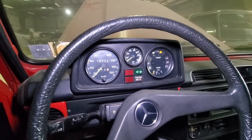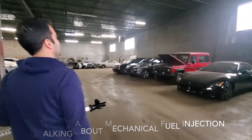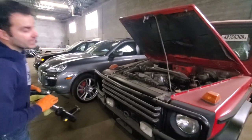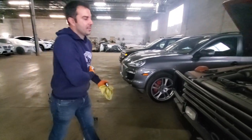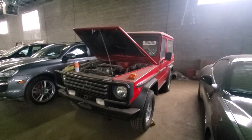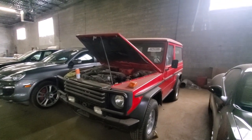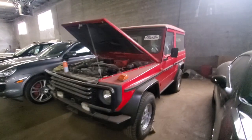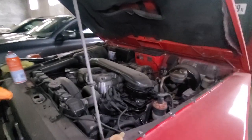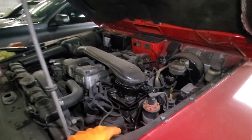The integral and one of the most complicated and expensive parts of these Mercedes - whoever owned this car completely eliminated it for a way older technology that's supposed to be inferior, but in reality just works. I'm feeling a little bit defeated. I know there's probably some carbureted American cars over there that we can get fired up. But I want to get one old Euro car started, and this is so par for the course that none of these will run. Check this out - this is very unique. It's another old G-Wagon, and they ripped out that central fuel distributor and it has a carburetor. They just slapped a carburetor on this thing.